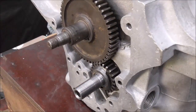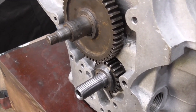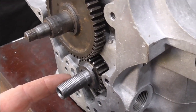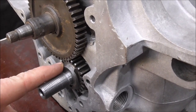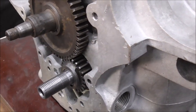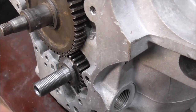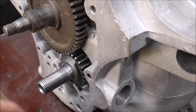Getting the cases. Just before I temporarily assemble the cases yet again, one of the main considerations for crank positioning is that your gears are in line on the other side. It's no good having it centralised in the crank if your gears are sort of half out of mesh and things like that. So it's just something to check when you're building engines up.